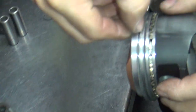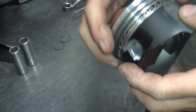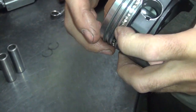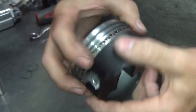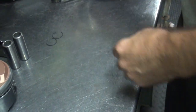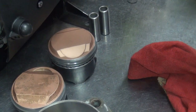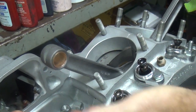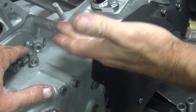See, when you have that detonation groove in there, it kind of confuses you a little bit. Okay, so they spin nice and free. There's my gap for that ring. That's because it's the front. See, when the motor turns over, all the grit hits this side here first. The motor goes this direction, all the grit hits the rear cylinder, and whenever it gets past the rear cylinder it hits the front cylinder. So the rear cylinder is like a filter for the front.